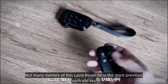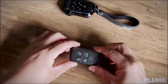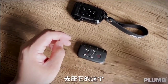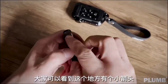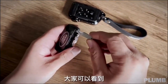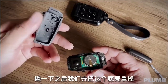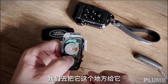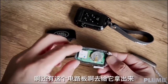Many Land Rover owners have an older model key. If you have an older model key, we will include a special adapter piece. Here we go to disassemble the old key case. Push from the side at the arrow position to remove the housing, then remove the mechanical key. Also remove the housing using the mechanical key. You can see this area is held together with plastic welding — use our tools to break the weld. Then take out the board we need to use.